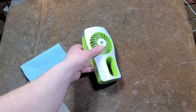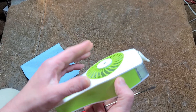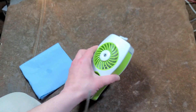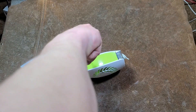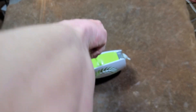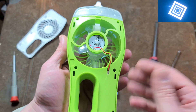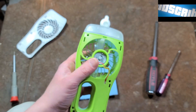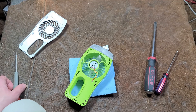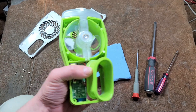I figured let's take it apart and just take a quick look inside. This thing is either snapped or glued together — I can feel a little bit of flex, so I figured these panels are snapped together. I'm going to try to use a screwdriver here just to pop them off. After damaging it, I should have known it was the back cover that snaps off. Then we have six screws to get in there. They're just using a regular brush DC motor, not even a brushless computer fan motor. Surprising — well, not so surprising, but you'd think for almost 20 bucks they'd at least put in a brushless motor.